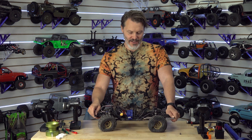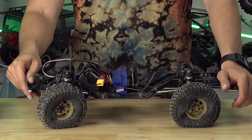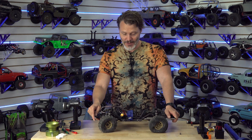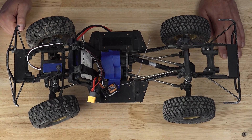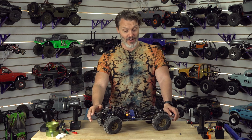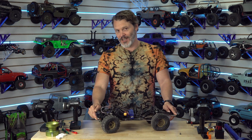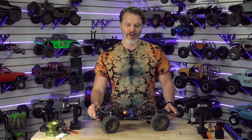So where's the line on overheating your ESC? You can always upsize an ESC on most brushless systems. I don't know where that line is yet, but I'm going to find it. I geared down — that's probably the biggest reason why I ripped the tires off, going from an 18 to a 12 tooth pinion — but it was still stalling less. This is really just illustrative of 'volt up, gear down.' I like the wheel speed of the 1800 KV on 3S with a 12 tooth pinion in this Element Enduro, but going to 4S I'd get similar wheel speed with more torque, better low speed control, better drag brake — just everything all down the line. Volt up, gear down, or sometimes KV up, gear down at the same time.